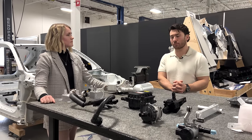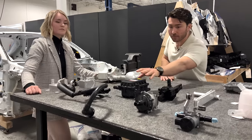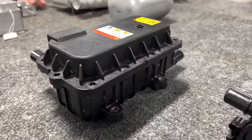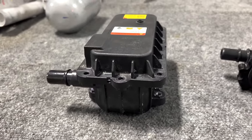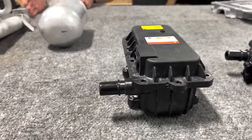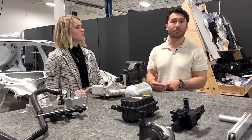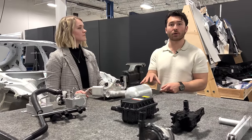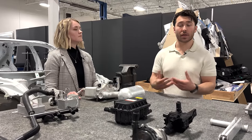One thing branching from that to the battery loop is the existence of this battery heater. One of the high-level things about this vehicle, the Ioniq 5, as well as the Kia EV6, is that this system is a heat pump system. So, as we'll go into a little bit later, heat scavenged from the powertrain is then used for cabin heating. As a consequence of that, for cold weather conditions, there still needs to be some mechanism for heating the battery so that the lithium ion cells are in a comfortable range for charging and discharging without affecting life cycle or causing any potential danger inside the cells.